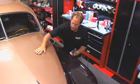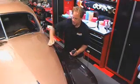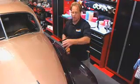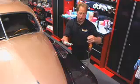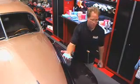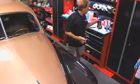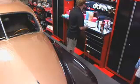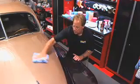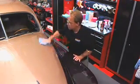When I first started out, I could kind of feel this dragging. Now it's gliding effortlessly. Then you can turn it over after you've clayed a big enough section, and usually whatever's on the car you're going to see show up on the clay. Now, say if this had red overspray paint, when we flip this over, you'd see a red tinge on there. So that's how that works. Then after you clay a section, take a clean microfiber towel, wipe that section clean, then you can move on to the next section. And that is how simple claying is.